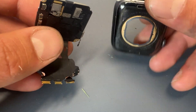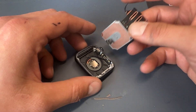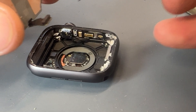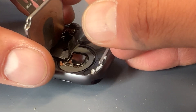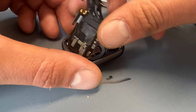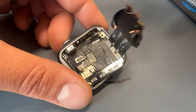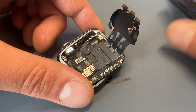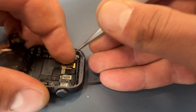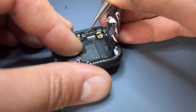In terms of reassembly, it's the same steps as we've just taken but in reverse. We can start reassembling the device by connecting the bottom of the logic board to the heart rate sensor and then carefully slotting in the logic board into place. Just be careful around that flex cable — if it catches underneath, you can have trouble reassembling it. Now we can reconnect the antenna cable.